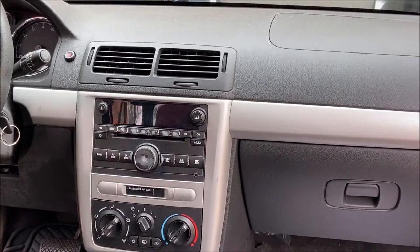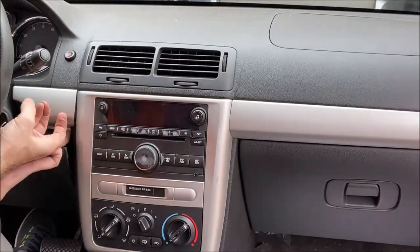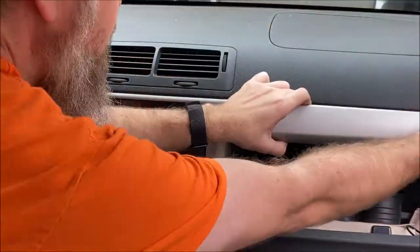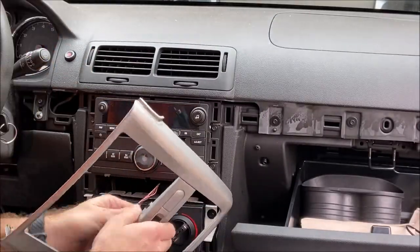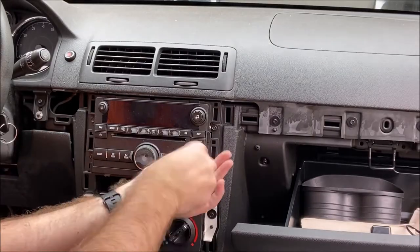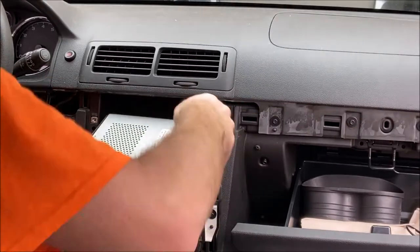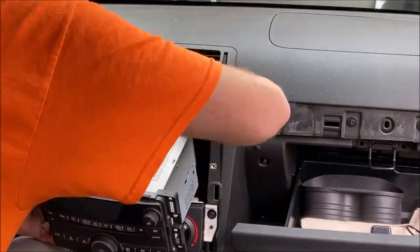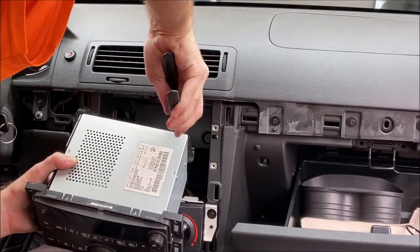It's time to put it into the car, so disconnect the negative battery first to make sure you're not going to electrocute anything, and you've got to take the trim pieces off. On the left side there are two clips, four over the glove box, and six in the central trim piece. I'm going to post a link to Ridgepin's video that goes through step by step how to remove the radio. There are four screws that hold it in, it pulls straight out, and there are two connectors in the back plus the antenna cable. I'll show you how I kind of messed up the antenna cable.